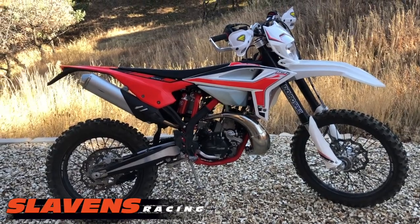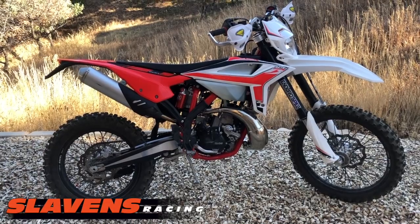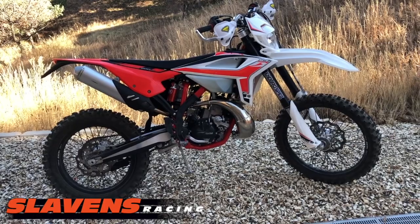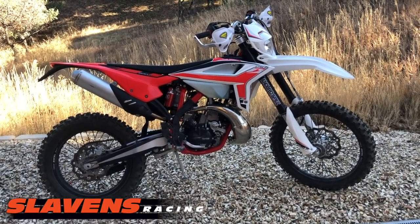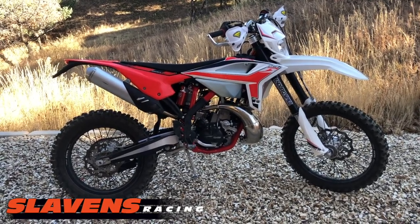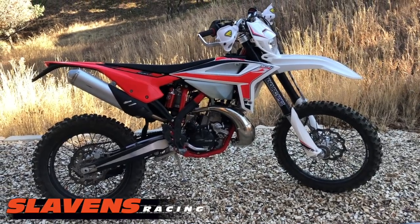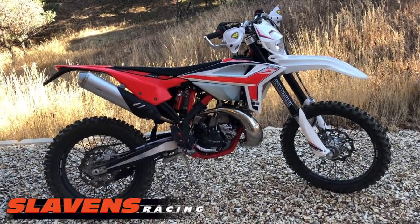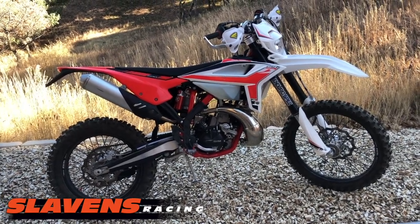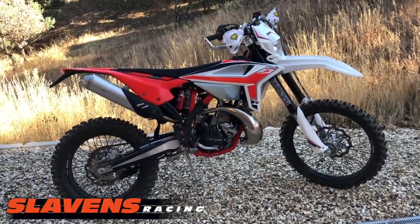Now with the Billetron Carburetor, the decking that I did on the cylinder and this pipe, it's totally transformed it. It's a totally different bike to ride now. It feels like a nice running stock 250, and I think it would give a stock 250 a good run for the money. So now it's got a nice bottom end. It pulls smoother into the mid-range, so you don't get that hard hit and that lighten up the tire and back end going sideways on you. It's just a lot easier to ride now.